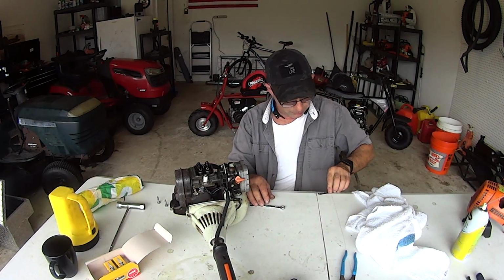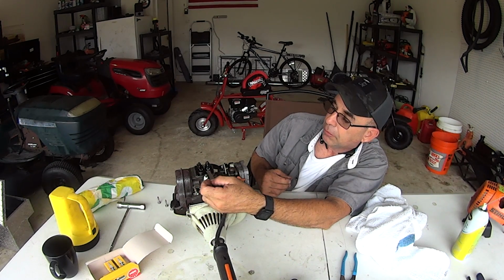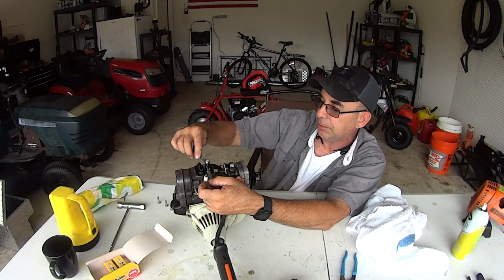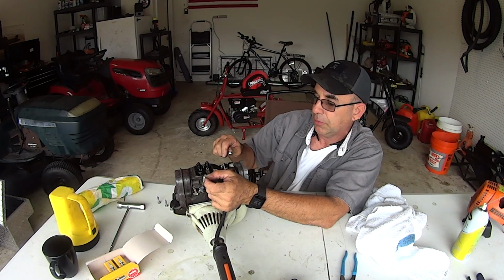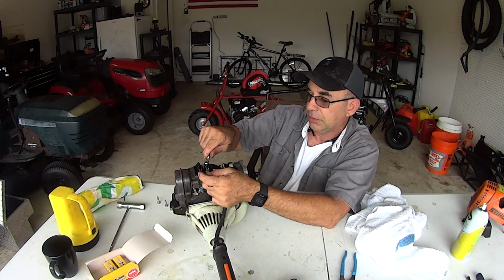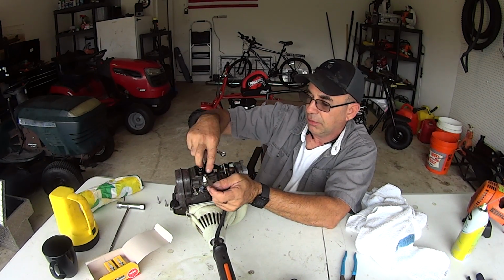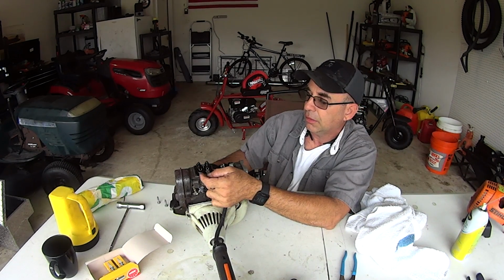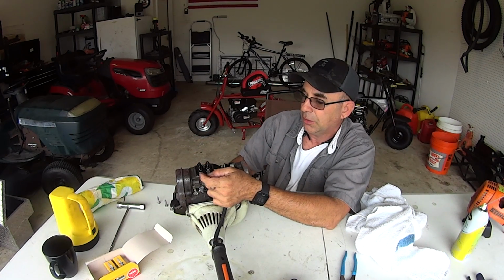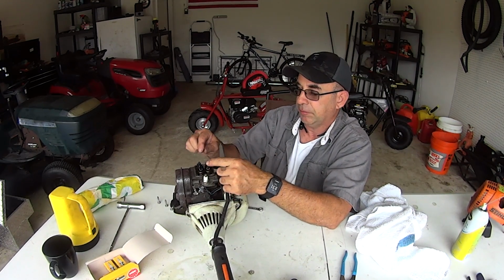All right, now, back to where we were. Right in from the front, check your gap. And that's loose. There's not really much drag there. So what we're gonna do is tighten this up about an eighth of a turn at a time. Oh, that's too tight. So I'll come back just a little. And there's a little drag. A little tighter. There we go. I like how that feels right there. That feels good.